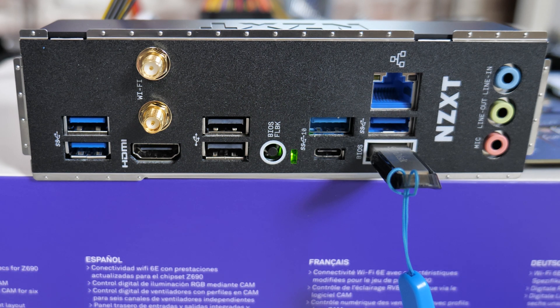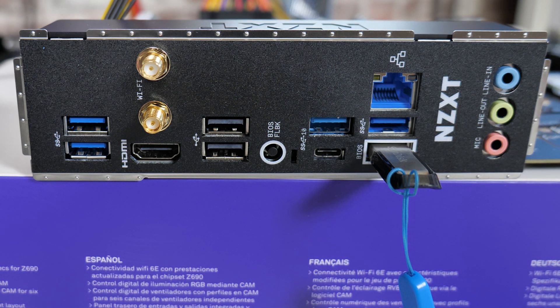The BIOS is now flashing, and you can see there is a steady flash on the BIOS light. If for some reason your USB drive just stops or you get a solid green light, you may need to make sure your disk drive is actually converted to MBR format rather than GPT. You can do that using the diskpart command — there will be a link in the video description for how to convert your drive from GPT to MBR. So if you've got to this point and you've got a solid green LED, click on that video link in the description and you should be able to continue from there.